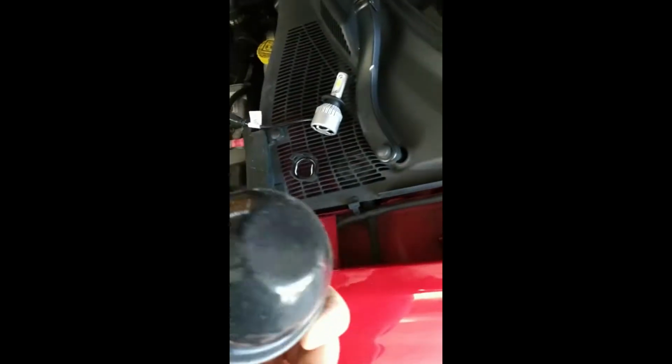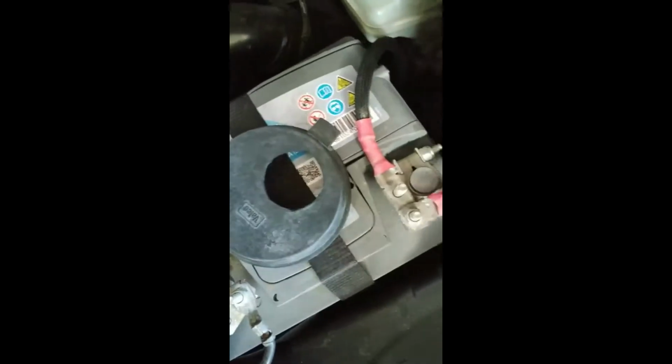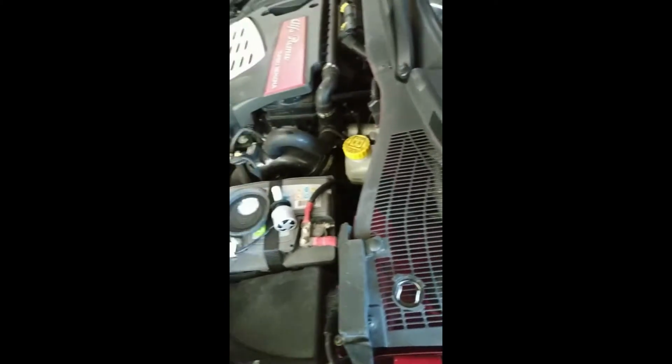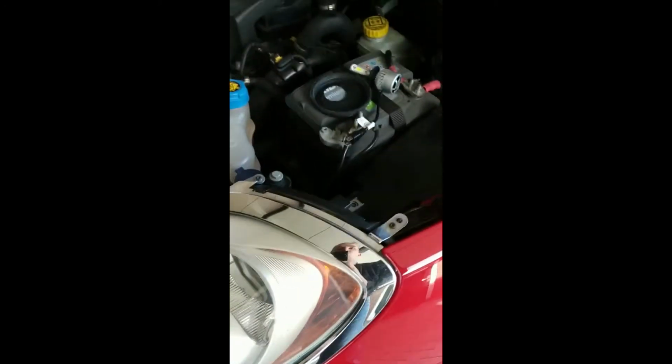So you don't have to use this dust cap. I will show you how I did it before I bought these. So first you're going to get to the light, and then here it's not this dust cap, but the lower dust cap. As you can see, there's a hole in it that's not supposed to be there. So I cut a hole in it with a knife so that it would have room to cool, because the normal dust cap will sit against this and will get really hot. So I use this. Only problem with this is if you are in a very moist environment, you are possibly going to get moist in here, and you don't want that. So I bought this one just to be sure.